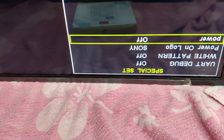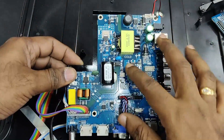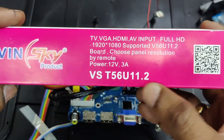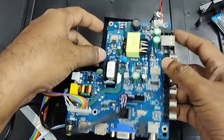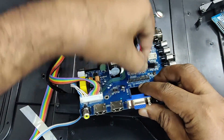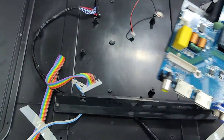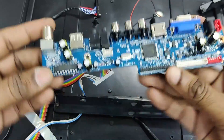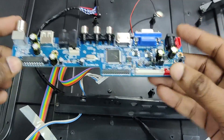Now let us see how to match the V56 board with this 32-inch LED TV. The VST56U11.2 is a slim board and you can match it with even up to 55-inch TVs. Let us remove the combo board — remove the LVDS connector, IR connector, and keyboard connector. This V56U11 is a jumper board and a slim board, and it needs a separate power source.